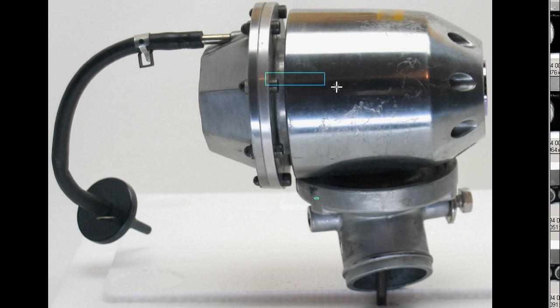The diaphragm is attached to a small piston in this area here, which then, when it pulls back, will release small chirps of boost through the little funnel here, giving that distinctive HKS SQV blow-off valve sound through the trumpet at the front.